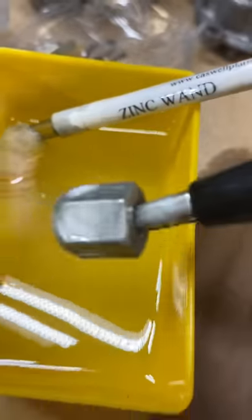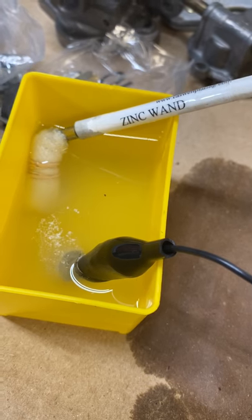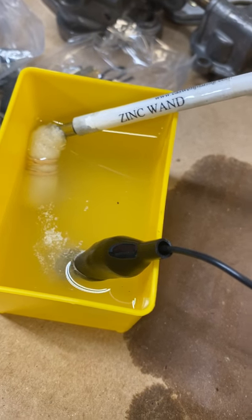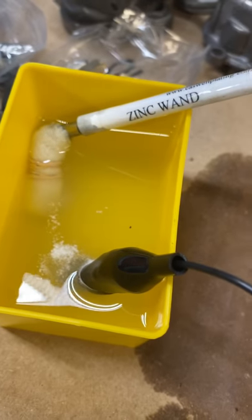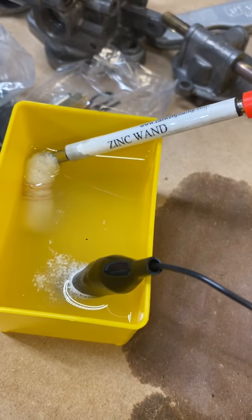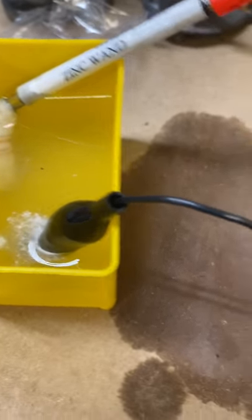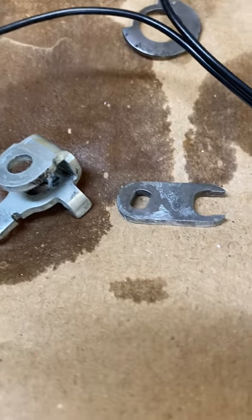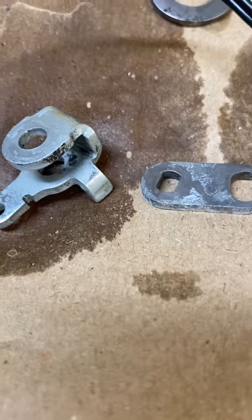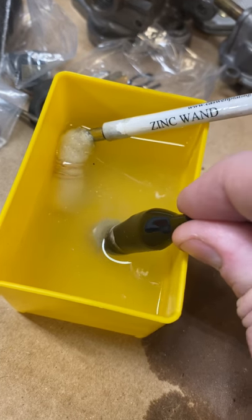You can see it's already looking better. A few more minutes in there — I don't really need to be holding it and messing with it. I should probably be wearing gloves but I don't really want to waste those right now. I've got some but I feel guilty for not having donated them. You can see the difference — the part on the left has been plated, the part on the right hasn't. There's definitely still some pitting on some surfaces, probably got some dirt ground in there.